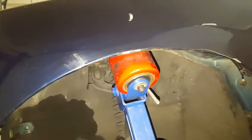Now we have the fender heated up on the outside and on the inside and it should be hot to touch — not enough to burn you but enough to notice a difference in the heat. We're going to start rolling and the previous body damage is going to play some effect in this. Since we have a little bit of tension right now it's just rolling, and you can see the lip is starting to go back in — that's due to the fact that there was a dent right here previously and this was pushed inwards from a previous accident. Once you start rolling, the lip will start to decrease and you just keep adjusting, pull it a little bit out more each time, continue to roll until you have the clearance you desire and all of the lip has gone away.